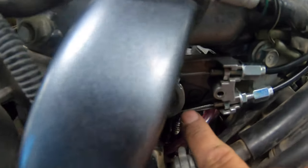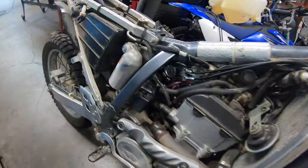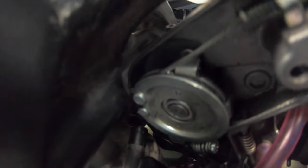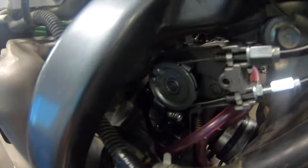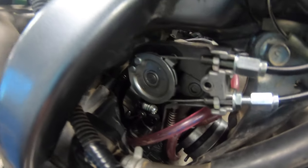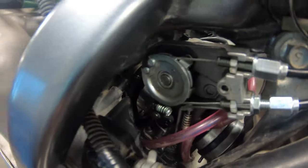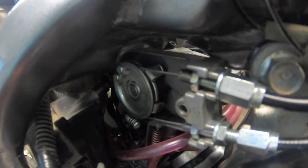Make sure this cable has a little bit of play — that's the main thing, this is just a safety cable. Also, if your throttle is sticking — see how close it is to the frame right there — if the plastic cover is hitting the wheel it won't come back all the way. The reason is it's not in there completely straight. You can cut the internal plastic, or tighten it all down and pull it away from the frame — that's the way I do it.